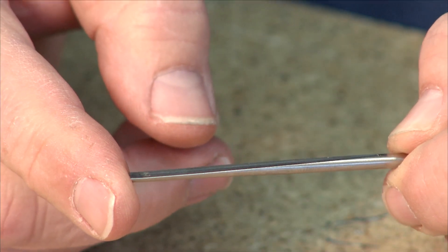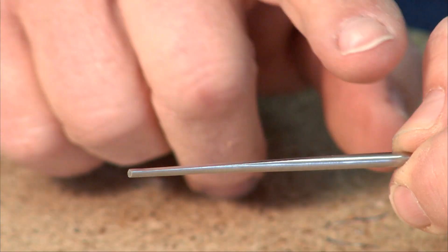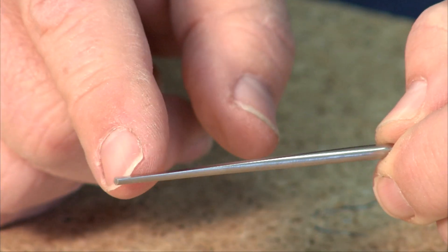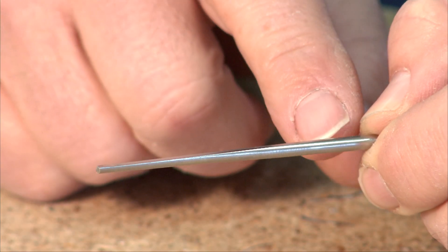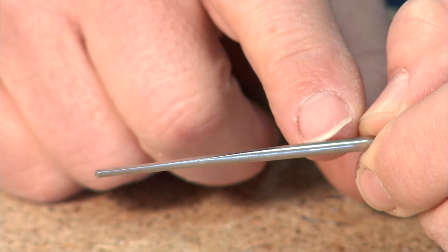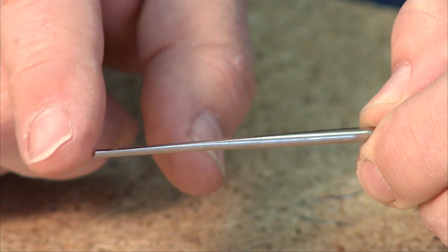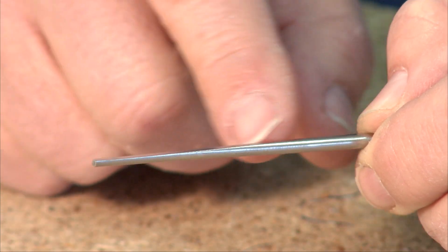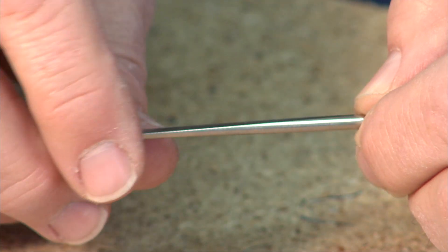The needles are numbered 1, 2, 2.5, 3, and 4. The higher the number, the steeper the taper. So the higher-number needles will be richer at the wide-open-throttle end and commensurately leaner at the closed-throttle or idle end. You'll use the proper needle to match your engine and tune it in accordance with the Aero Injector manual, which talks about several steps.